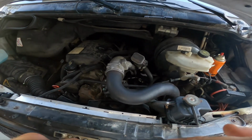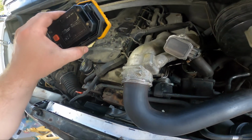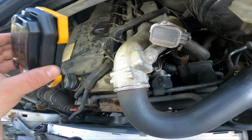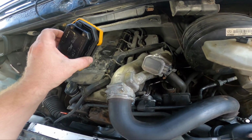Oh, glow plugs, yay. Everyone says to do them while they're hot. And I already know from looking earlier that this first one, somebody done goofed and it's broken. So we're going to try to get 2, 3, 4, and 5 out. And then we'll deal with number 1.